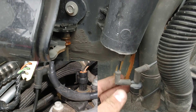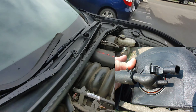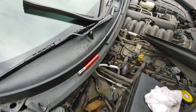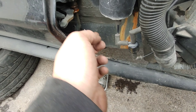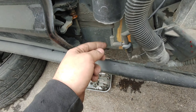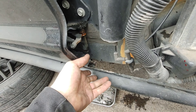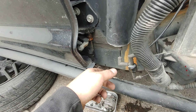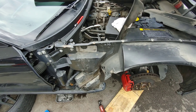I could see right at the rear of the intake — you probably won't be able to see it in the video — but there's a kind of 90-degree plug at the back of the intake manifold right there, and I felt that the pipe was not plugged into that connector. So I took the line and replugged it into the connector at the back of the intake manifold, and voilà — everything works again. I can now send air wherever I want. It's a big job for just one unplugged pipe.